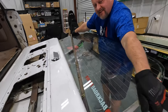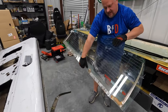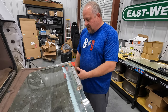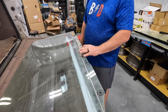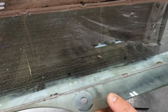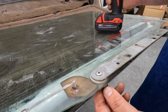It's fun to pull this out but these catch up on you — not too bad, it'll come on out. So we have these brackets that the mechanism is attached to. We've got to remove these to put them on the new glass because the new glass doesn't come with them. We've already removed one — it's pop-riveted on, so you're going to have to take a drill and drill these out. The hole in the glass is much bigger than the drill bit, so you don't have to worry about hitting the glass and shattering it. Just be sure you don't tear up these plastic washers because we're going to reuse those.